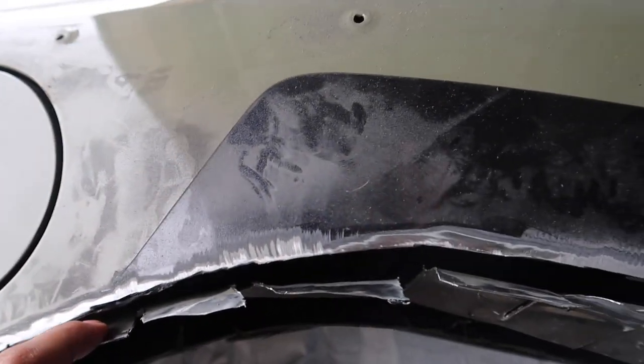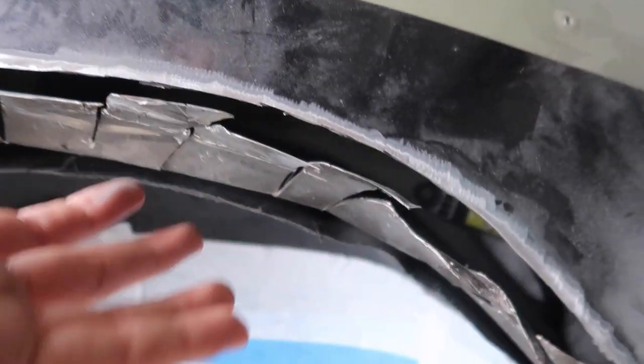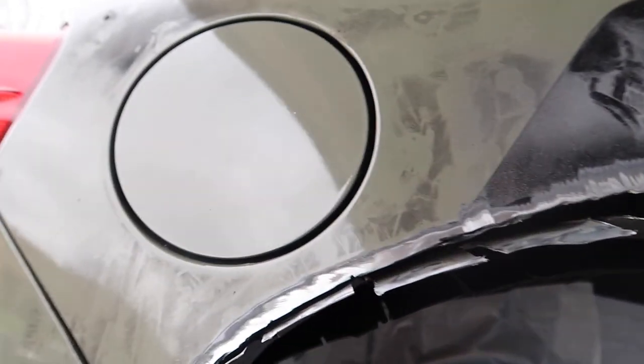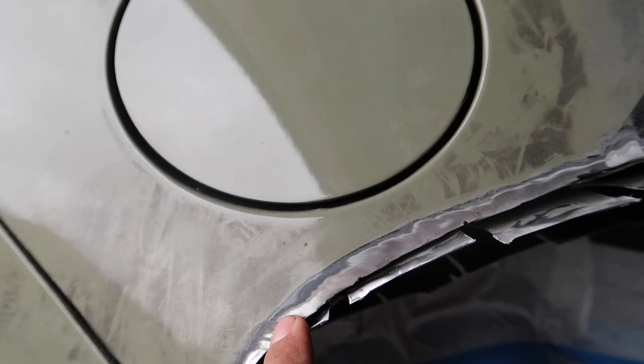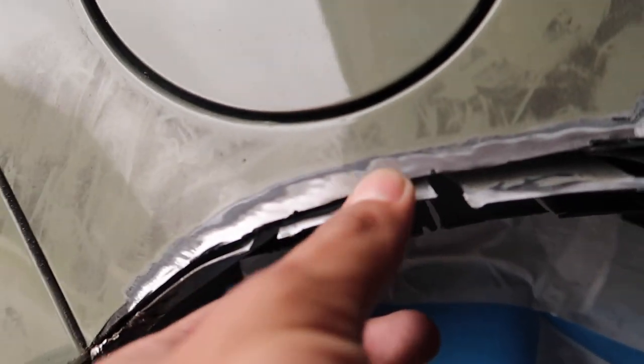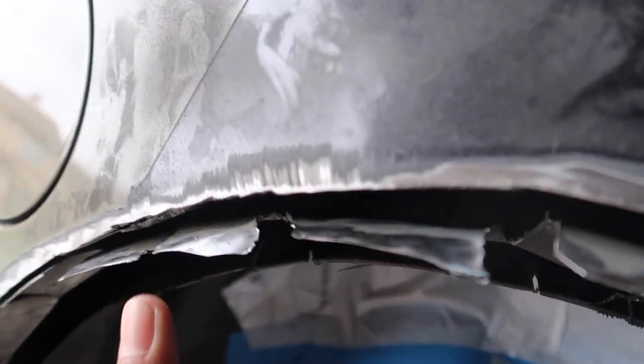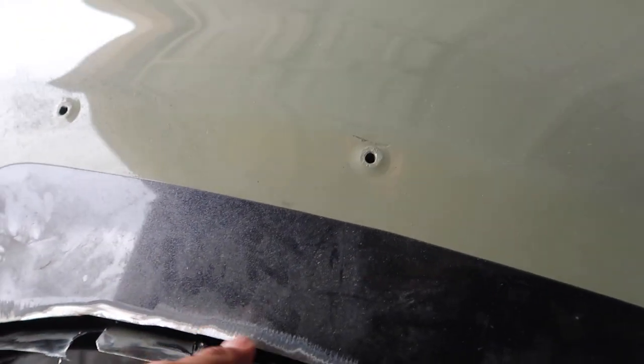Alright y'all, so pretty much what just went down was, after you cut your slits, like I said, make sure you go high enough so that you're able to air out lower or ride lower, whatever you're on. And before welding, you want to grind it till it's bare metal, so that the weld can stick better and you have no problems with it unsticking. Then once it's all welded, you're going to want to put some adhesive on there just to seal it up and make it secure.